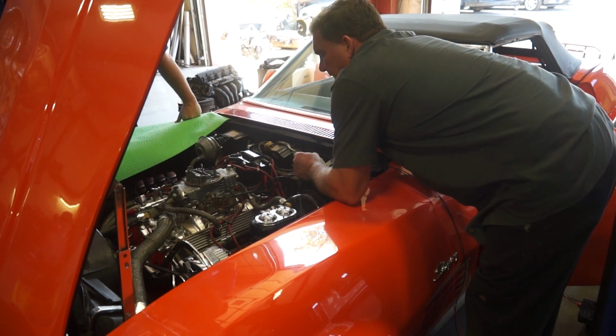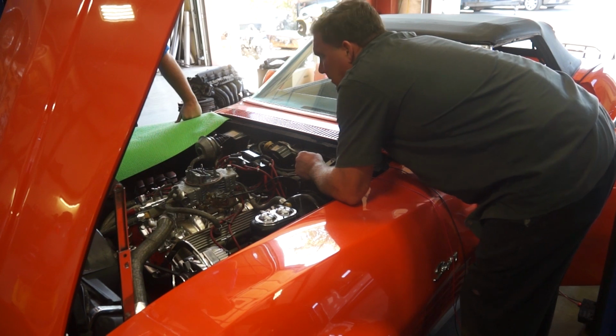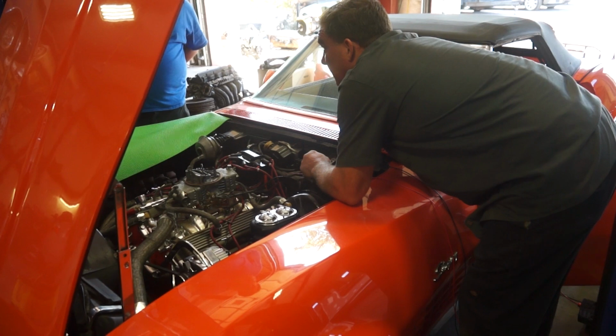I wonder if they were fighting ignition timing problems because the brand new distributor is no good. Is there power to the distributor, just not out of the distributor? I supplied power direct from the battery to it. Sounds like it needs a distributor. Right. That's what it's looking like. That's easy. It's a tach drive distributor though. I don't know how easy that is.